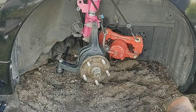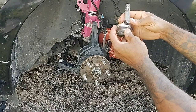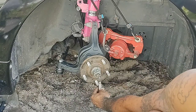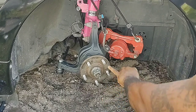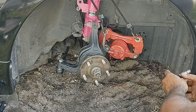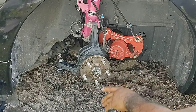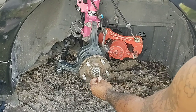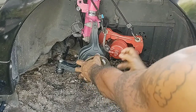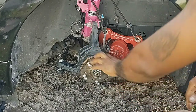That's when you'll have access to the bottom of your ball joint, right here. I ended up doing it the hard way, so you guys can learn from my mistakes. The ball joint is up under here. I tried to hammer it out from the top, but there's no space, so I ended up pulling the whole CV axle assembly out to get to that part where I could hammer it down. Once you pull it out and take the nut off, let the CV axle drop and you have access to the ball joint.